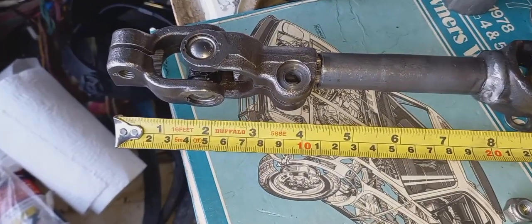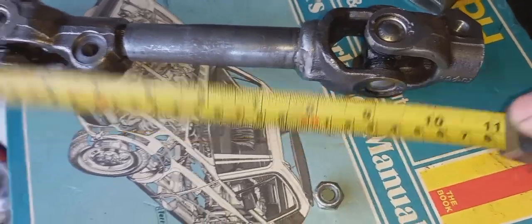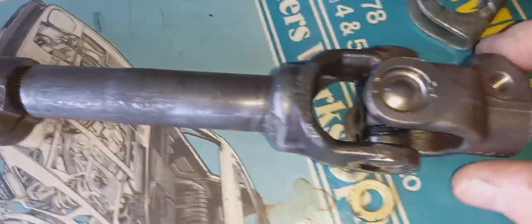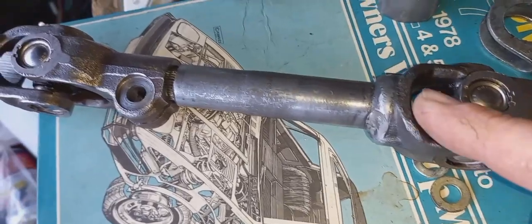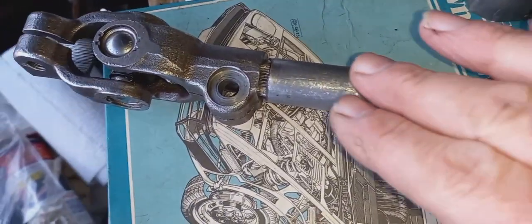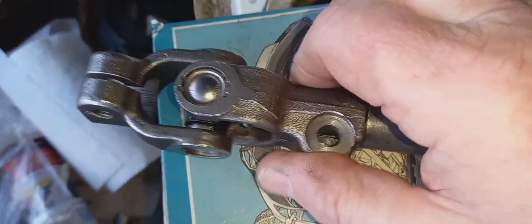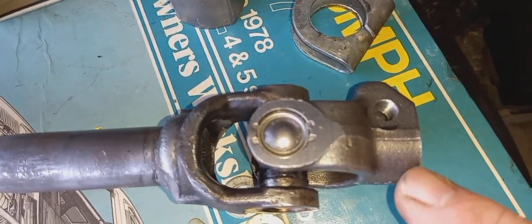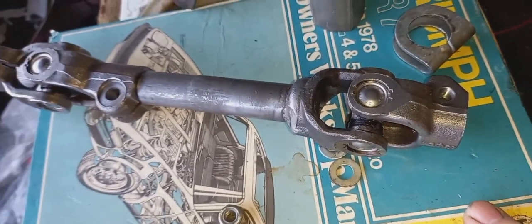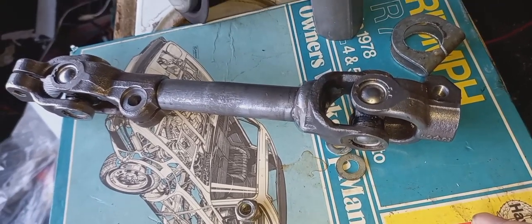As a minimum, I need to achieve 270 millimetres. This connects onto the existing shaft which goes onto the rack. This is all part of the easy steer — that universal joint, this tube which fits through the bulkhead, this spline shaft which I did cut, so that moves like that, and this end fits on the end of that gearbox. So between there and there I need 270 millimetres. It's looking like I'm going to have to cut the spline shaft that comes out of the gearbox — I'll have a little think about that.